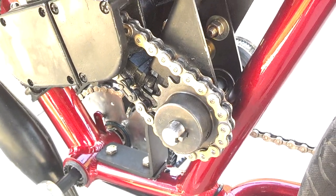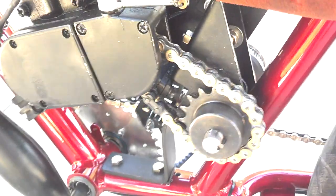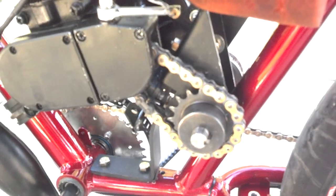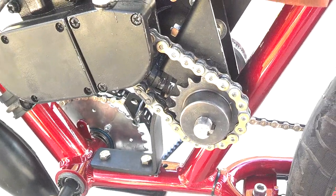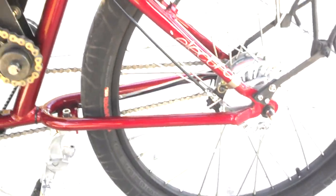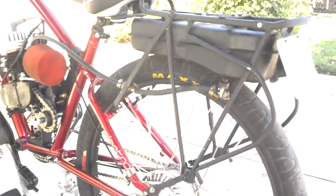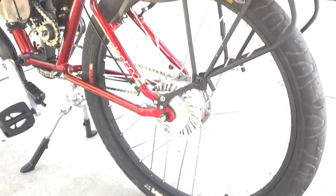This Regina race chain is sweet. Any of you guys that have used chain from racing go-karts know this chain is good for 12 horsepower. For the Sick Bike Parts crowd using these setups, it's an absolute must because I hate the chain stretch you get from standard chain — it's a real pain. We've got a high-performance motor with high-compression heads that tear standard chain up.